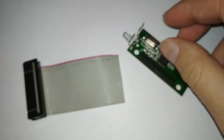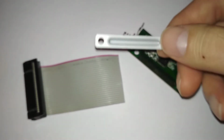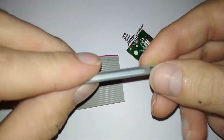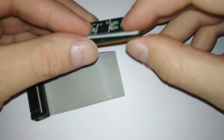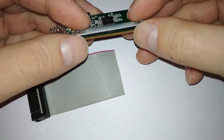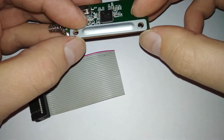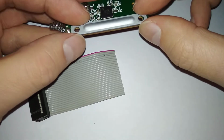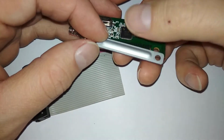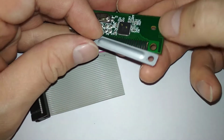Where is it? I had it here. Anyway, the keyboard's own parts. This is used to hold the rubber piece here, which presses down the wires or circuitry to the circuit board, so it will make contact. So I will just press the wires here. Hopefully there will be no shorts.